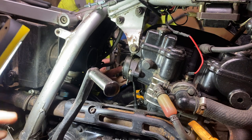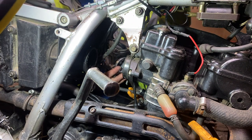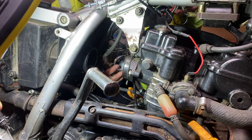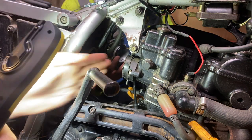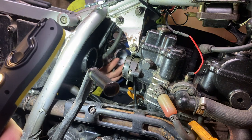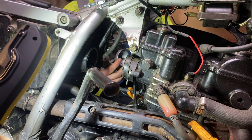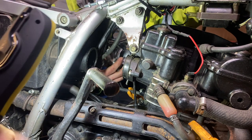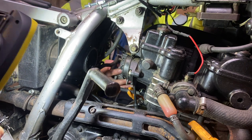Well, there it goes. It's gone out the other way. So Kieran removed the coolant tank, which I think was just held on with one bolt up the top there, was it? Yeah, pretty much. And that's given all the access on the other side to just pull that out. So what we said earlier about cutting the frame and the exhaust, like, don't do that. Just silly idea. Take the coolant tank off and send it out that way. Easy when you do it the right way, it seems.